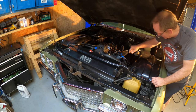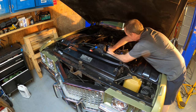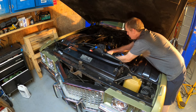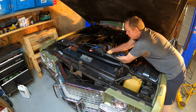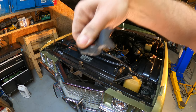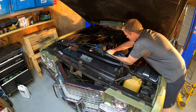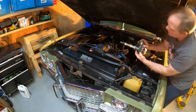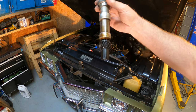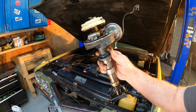I'm going to have to put the new one on after I get the distributor out. Let's not forget to remove the vacuum hose to the advance unit — these vacuum lines with a little bit of heat just weld themselves to everything. And that little hold-down bracket will make your life miserable. There's our original breaker points distributor — such a sad day to see an old part like this go out of commission.